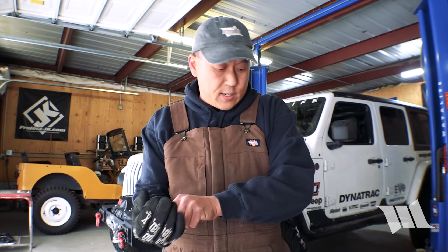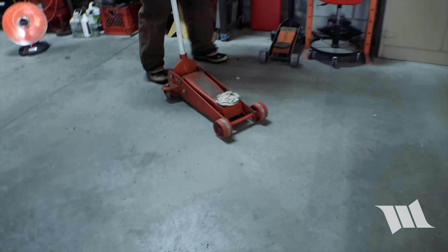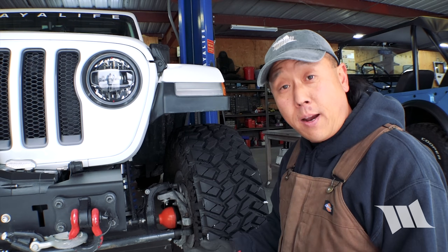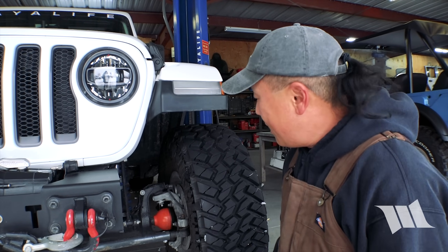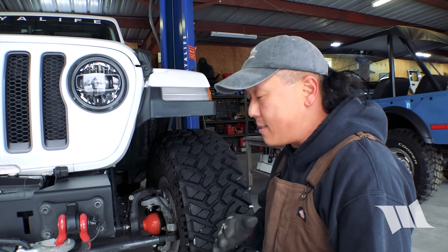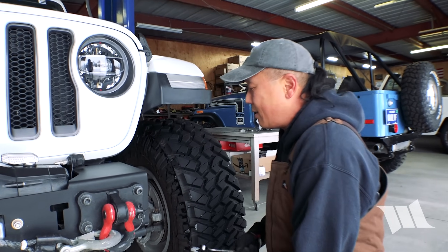Because it is winter all of a sudden, I'm going to have to wear a pair of gloves. Before we can install the track bar reinforcement bracket, we're going to have to first remove the track bar from the frame rail mounts. The best way to do that is with the full weight of the vehicle on the ground, because that will keep everything in position and make it a lot easier to extract the bolts. So, using a 21mm socket and wrench, we're going to separate this thing now.